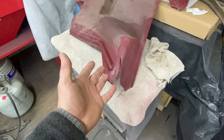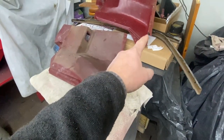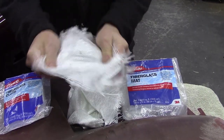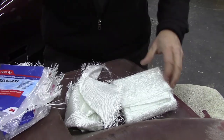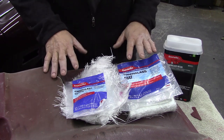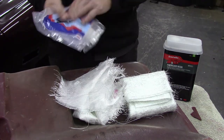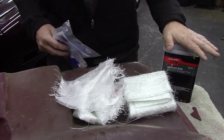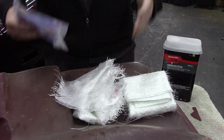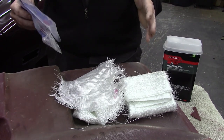What I'm going to do now is pretty much just use some fiberglass matting and cloth and resin. We're going to go ahead and rebuild this, using that side as a template. We've got fiberglass cloth, which is kind of this woven material — a lot tighter weave than this fiberglass mat, which is just kind of stranded together. The most popular video on my channel compares fiberglass cloth with fiberglass matting and also the different types of resins. There's an epoxy resin and a hybrid resin. What type of material you're working on will determine the best type of resin to use. Go back and check out that video if you want to learn more.